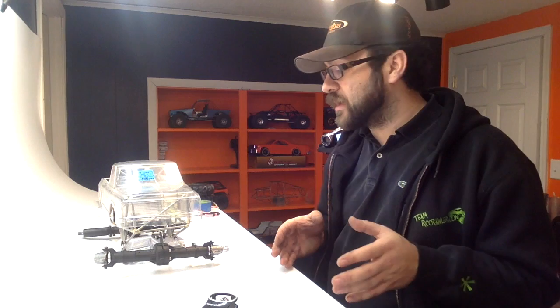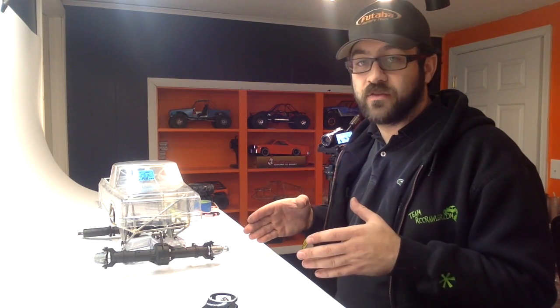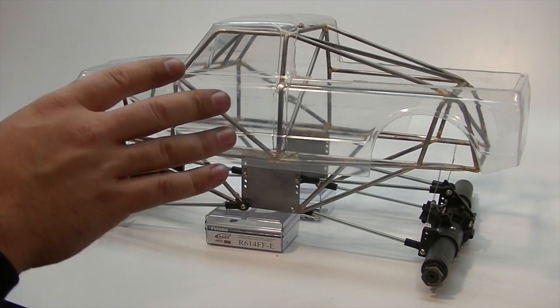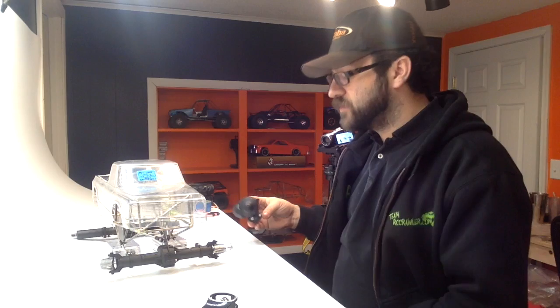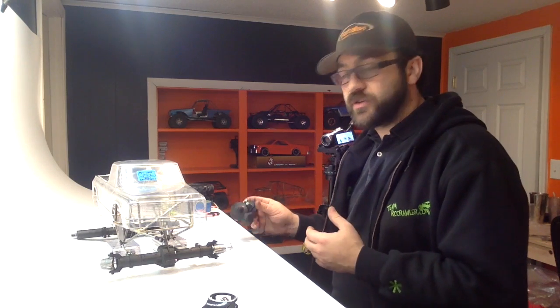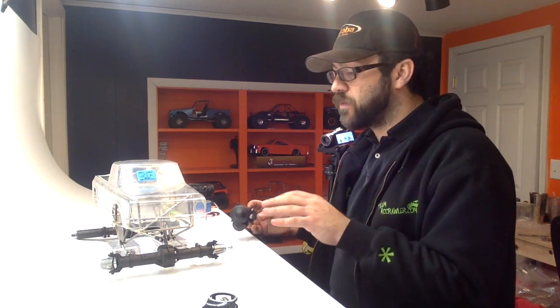After doing the shock mounts, the last thing I do will be to build the skid plate. I'm going to do a welded-in skid plate on this truck, but I wanted to get the suspension links done first — I wanted to see where the suspension links would have to mount as far as inside versus outside of those vertical plates on the chassis. That is mainly controlled by the servo location in the front axle. I need to make sure I had those links far enough out that I could get my shock and lower link mounts to mount on the axle to the outside of the servo. I'll probably match that look in the rear just so everything looks even as it flows from front to back.